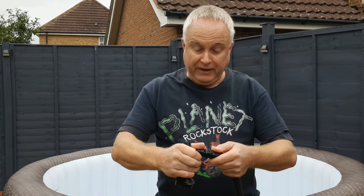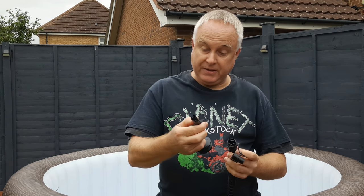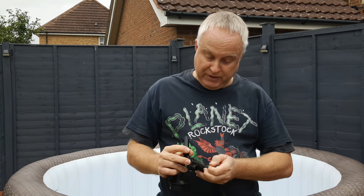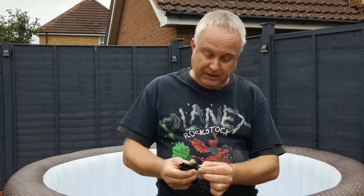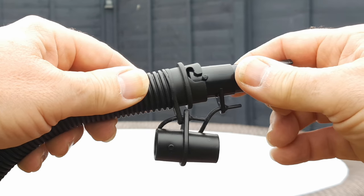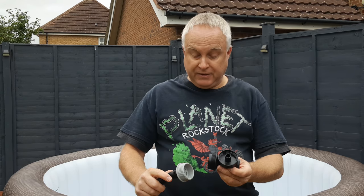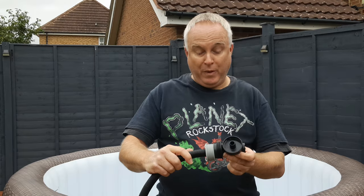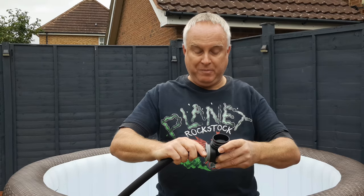Remove the filling adapter from the end of the hose and place the deflation adapter in the hose. You can fit it to the little tag first if you wish, and then fit it into the end of the hose. At this end, fit this to the adapter — it'll only go on one way around, which should be obvious. Don't do it overly tight, just snug it down.